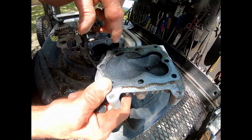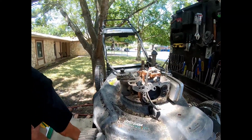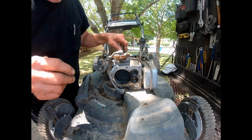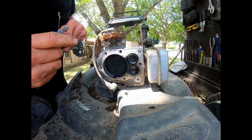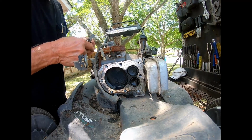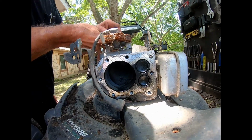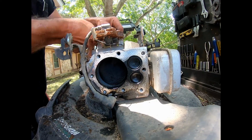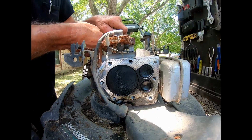So now the last thing here, well, one of the last things, in the head, if you take the head off, all this is just a flat head. There's the plug. And when you move the engine, yeah, boy, where's my button? So this one, here's your exhaust, here's your intake. So this is called a 4-cycle engine because as you turn it, here's top dead center, so down this would be this intake just closed, so this would be the power.